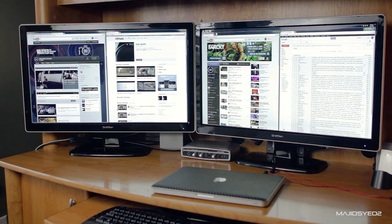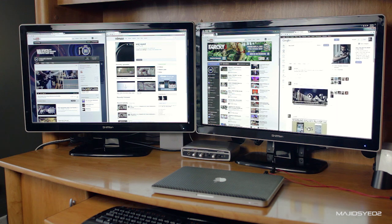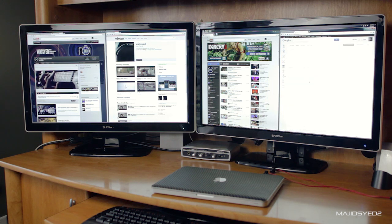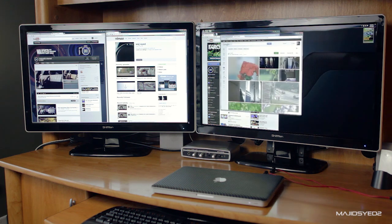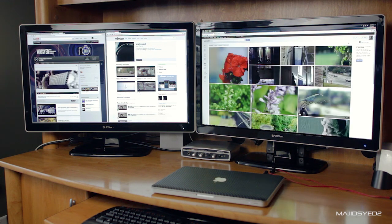Of course, I should point out that one of the reasons why you get a very competitive price on these monitors is that they are B selections, meaning that they didn't quite meet Apple's specifications, or whoever the main manufacturer's specification is, in terms of the specific criteria and parameters that the monitors have to live up to in order to sell the product by a specific company. For example, this may mean that the color accuracy of the panel might not be fully up to spec or up to recommendations for Apple's Cinema displays, so the manufacturer then has to bin the product, marking it as rejected or not quite up to specification. Keep in mind, these monitors are still perfectly good products. They still perform really well in terms of most of their parameters, but they're not 100% to the vendor's specifications.